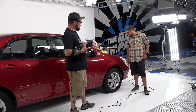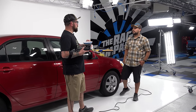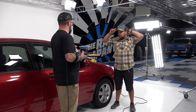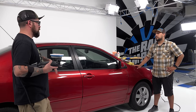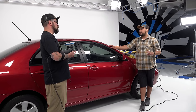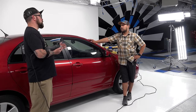It's a dent, but it's got a little mar in it. So you can slow down your arm speed and we can provide a little more correction in that spot. And then the rest of the car, like the top rails and the doors, a faster arm speed is going to be easier. On the faster arm speed, you want to go at a higher number. Not a crazy speed, and the motor speed can stay the same.